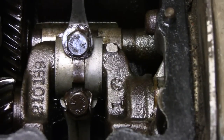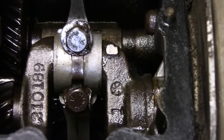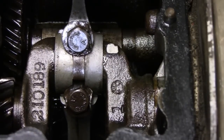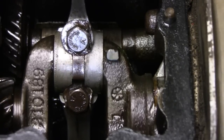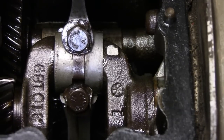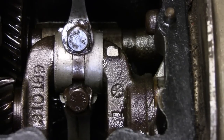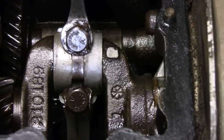I haven't started unbolting anything yet, but I did notice something — there is some play on that connecting rod. It's going down pretty far. There's a lot of play, and there are ways of fixing that or just changing the connecting rod. Chances are it's probably the connecting rod, not the crank, so let's take it off and deal with that.